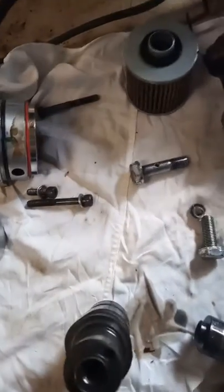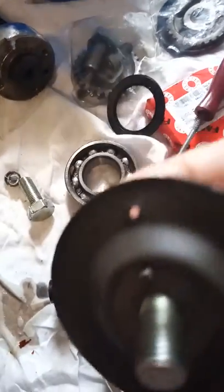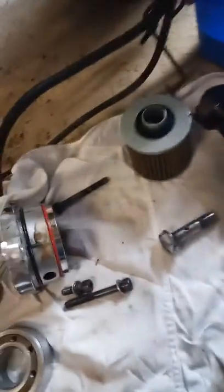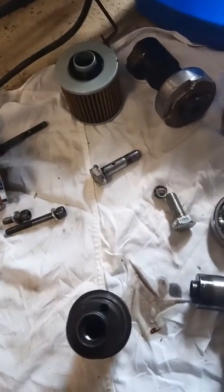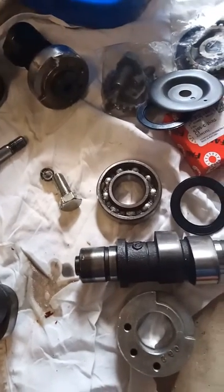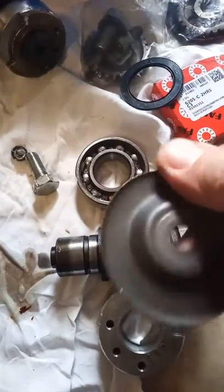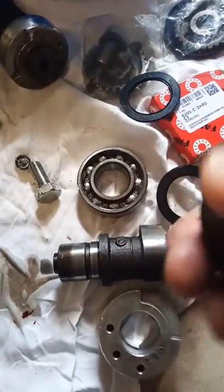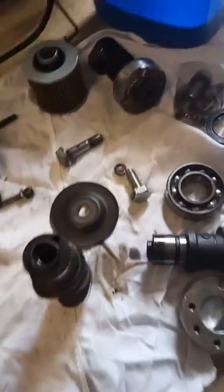I've got two covers and I'm going to put both on. If this is on the outside, it'll direct the oil off the cam chain and hopefully hold some oil back — maybe create a bit more splash back onto the bearing so it stays cool and oiled a bit better. I believe that this with that little lip will fling the oil back into the bearing. That's my thinking on it — someone else might have a different idea. This cam came without the pin in it, but I'll take the pin out of the other one.